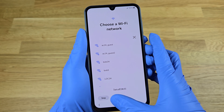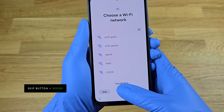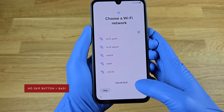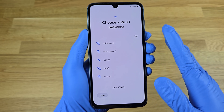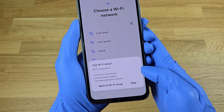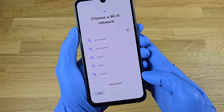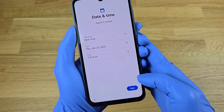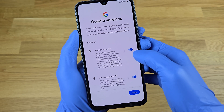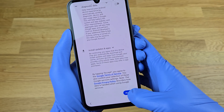These next few screens are super important. If you see the skip button in the left corner, that's a really good sign — we can jump straight into the phone. Same goes with the Google account login screen. If this skip button is not there, then we have a big problem, as it may be Google or Samsung locked by the previous customer. In that case there'd be nothing we can do other than returning the phone. We're going to press skip. If you're ever going to sell your device or do a trade-in, unlink and remove your existing accounts first before factory resetting. On the flip side, if you're buying from someone, make sure they unlink and remove the phone from their Google and Samsung accounts first.